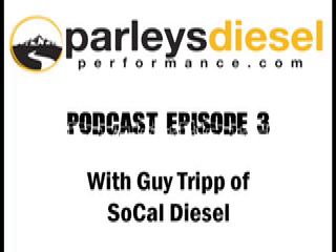Makes me regret being a Cummins owner, that's for sure. Yeah, we actually had that as part of our marketing campaign: how big is your Duramax? The current Duramaxes are 6.6 liter or 402 cubic inches, and this kit increases the displacement to 7.1 liter or 427 cubic inches. And 427 cubic inches, of course, was one of the magic numbers in Chevrolet racing history — the 427 Corvettes and Chevelles are very, very popular. So give me a 7.1 liter stroker kit, as if the Ford and Dodge guys don't have enough to worry about.